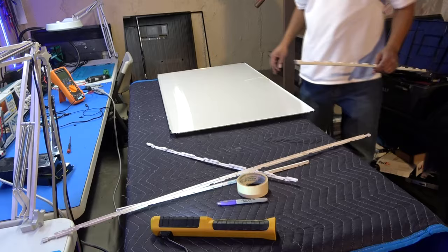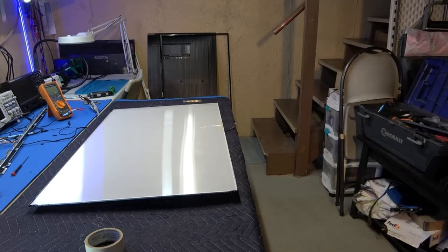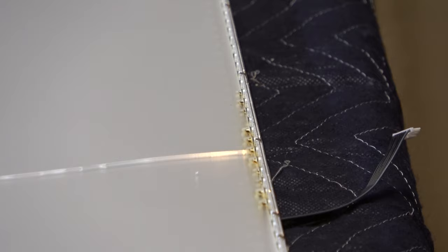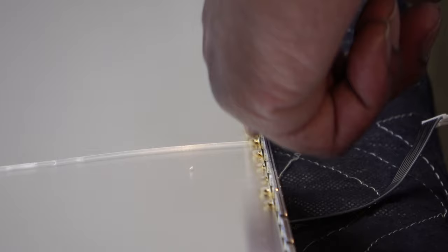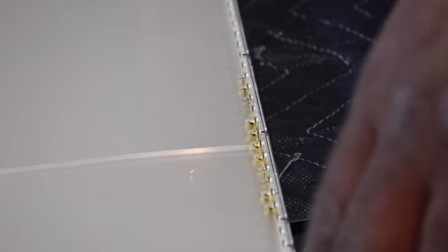And as you can see on that clear screen, where that crack is, you actually can see that crack came from the heat of the LEDs against that last diffuser screen, or the first one, okay. As you can see, this melted right here. So obviously the strip that blew out caught on fire or sparked or whatever. But I'm gonna get this last screen out.